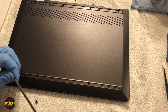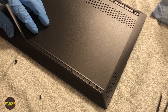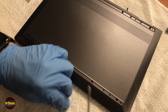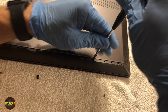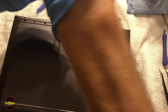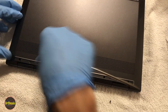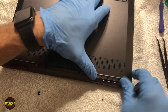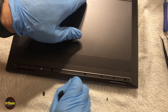It doesn't matter what order you replace the screws in. The cover won't stay fully seated until you get all the mounting screws back in. Note that the little ones on each end are the two Torx screws — almost forgot about that. We'll get the Phillips ones in first, four in the back, then flip it around and make sure the clips are seating before we get too much tension on the screws.